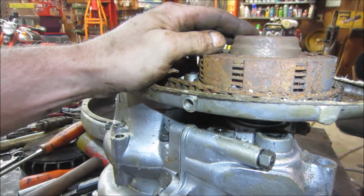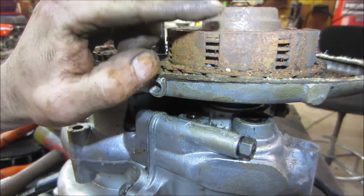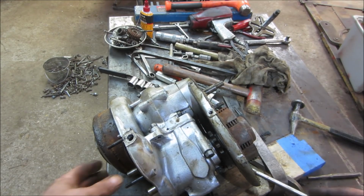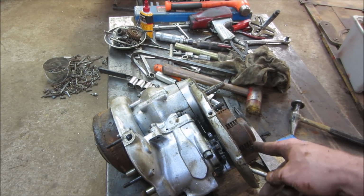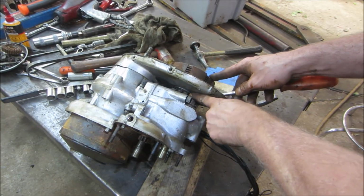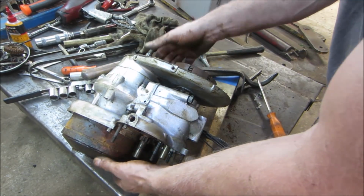That's going to be, so to release the clutch, this would get pushed up, I would think, and make room between the plates from the lever from the other side. I really haven't gotten anywhere, but if you rock that play back and forth, if you guys can see on this side, the gear case, the whole gear case kind of moves together. That sprocket is floating. I'll tell you one thing though, it must be a pain in the ass. You need to change the front sprocket. It seems like you have to take a lot of crap off to do that. Just a general maintenance kind of item.